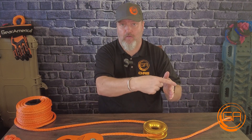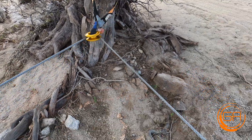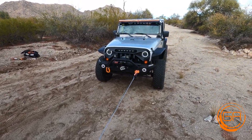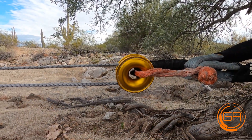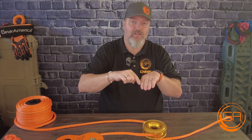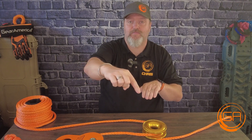To gain the mechanical advantage, you just need to be attached to the anchor points. If you run two snatch blocks, you go from your rig to the anchor, hook up a snatch block, back to your rig where you've got another snatch block attached, and back to the anchor point — two connections at the rig and two at the anchor. If you're just doing a change of direction, you're not getting a mechanical advantage, you're just changing the direction of the force. Using a snatch block to pull a buddy out of the mud when you're going one direction and he's coming up another is not going to give you mechanical advantage. If you want the mechanical advantage, go out to an anchor and back to yourself. If you went out to an anchor, back to yourself, and then to your buddy's rig, you'd be getting a mechanical advantage and a change of direction all at the same time — using a snatch block at the anchor, a snatch block at your bumper, and the line going out to your buddy.